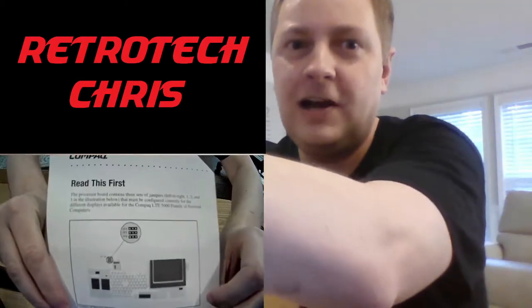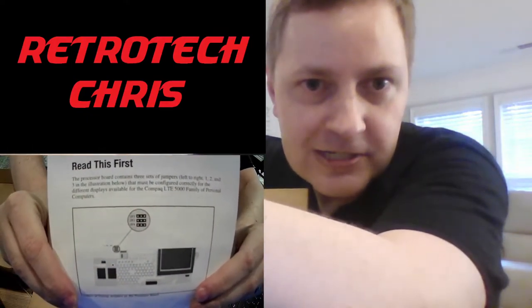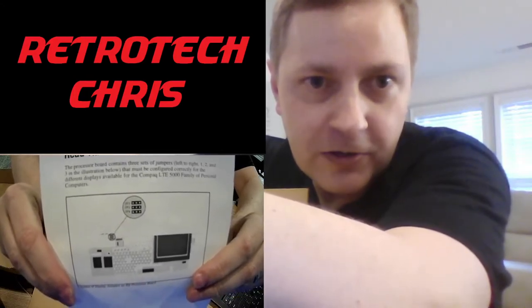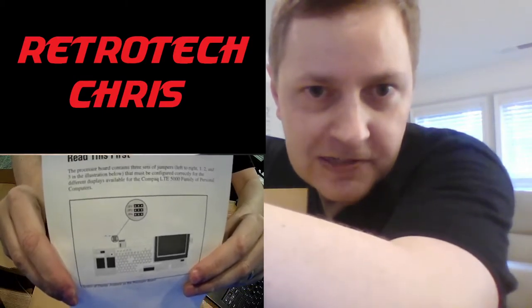So I'll have to tell the story someday, but maybe I have. I used to work at a Compaq center, so there were times where I got things new in box like you see here. Look at this. Read this first. It's talking about the jumper settings on the processor card. The processor board contains three sets of jumpers, left to right, 1, 2, and 3, that illustrate below. They must be configured correctly to the different displays available for the Compaq LTE 5000 family of personal computers. See that? They're a nice, happy family of personal computers.